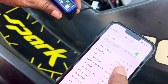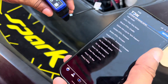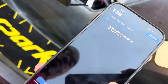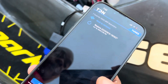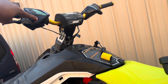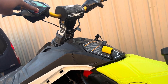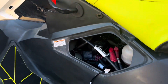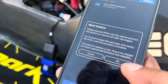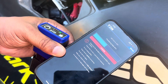I went back to Bluetooth settings just to show we're connected — everything's good to go. We're going back to the TDN app. We're going to download this map onto here — this is your restore. Everything's hooked up. You want to cut the power on and get your dash on. Make sure you don't start it, just keep the power on. Every now and then hit the red button to keep your dash lit. Now we go to Read Vehicle — the RTD is synchronizing and detecting your vehicle. We're downloading the restore file right now.